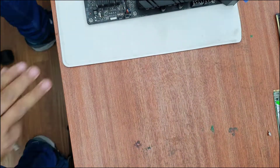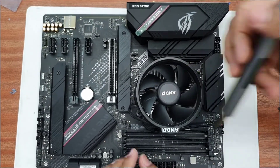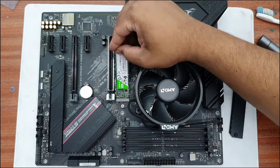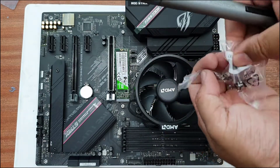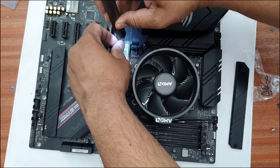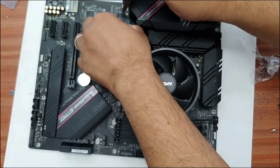This is also the time to remove your existing SSD. The B550 ROG Strix motherboard has two slots for M.2 NVMe SSD, and both of them come with a heat sink, so feel free to use either one for the same speed and advantage. The new motherboard also comes with an M.2 screw, so make sure you put it in the correct place and check it before you tighten it. Before you put the heat sink back, make sure you peel off the film protector, because the new motherboard has a film protector on it.